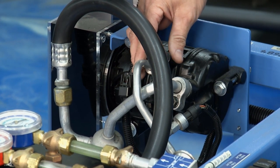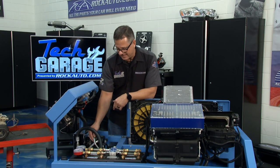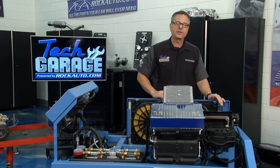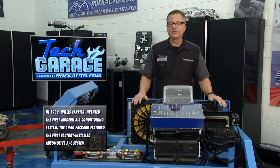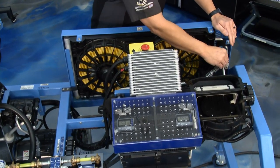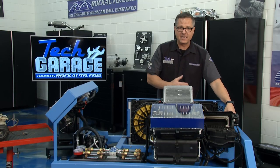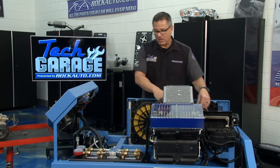On the high side, gas comes out of the compressor very, very hot. If you felt your compressor and one side is hot while the other is cold, at least you know the compressor is working. Then it goes over to the condenser on the front of the car — that's where we get rid of that heat. Think of your bathroom mirror: steam from a shower cools and turns into liquid. The fans are blowing, heat dissipation happens, and refrigerant goes in as a high-pressure gas and comes out as a high-pressure liquid. If you felt the two lines on the condenser, you should feel a difference — hot going in and warm coming out.